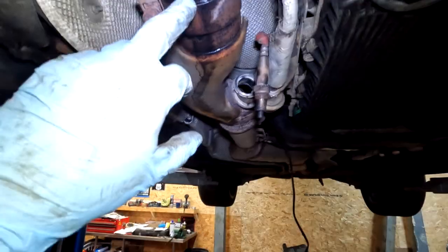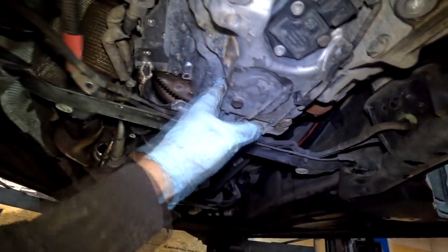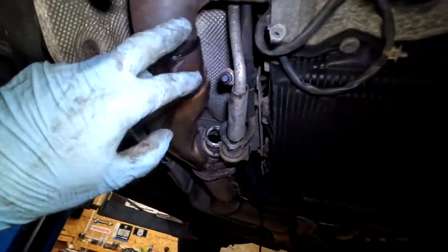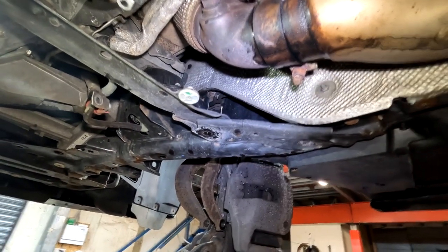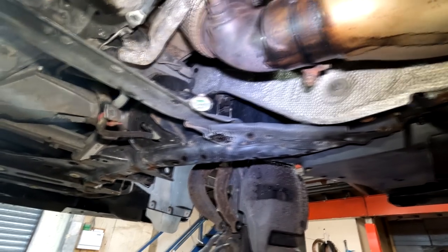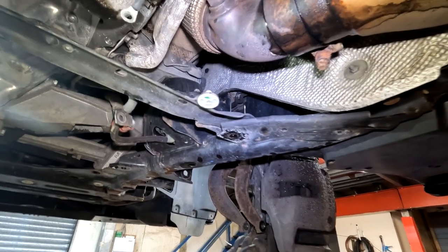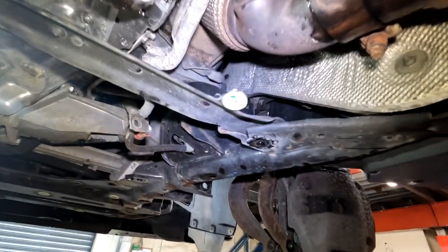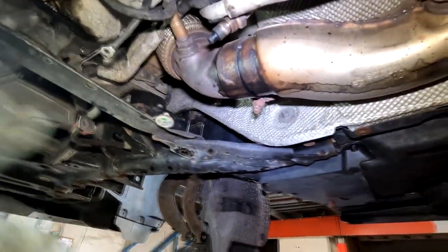Right, you can clearly tell there is something wrong. I already drained oil, and I would say it was below minimum 100%. And this I've cleaned, but you can see clearly we potentially got the DPF full of oil as well. Need to speak to the customer about what he wants to do with that. If you put it back together, obviously it's gonna smoke like hell in the beginning, but eventually it will burn out, but with time it's gonna clog up anyway. So we'll see what's the solution. Maybe take the DPF out and map it.